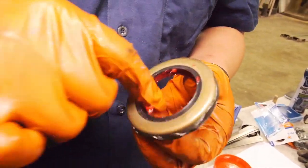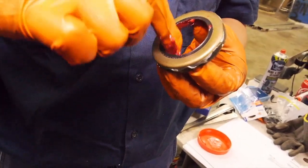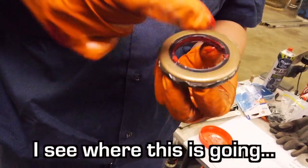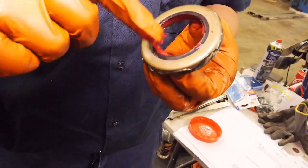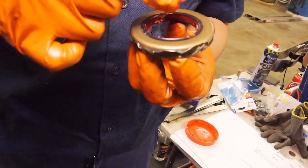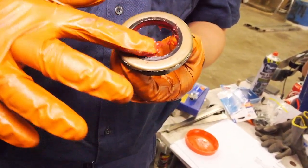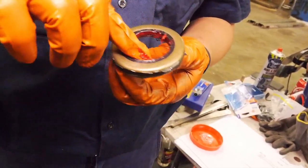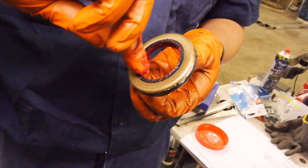The grease helps to stop the lip tearing - nobody likes a torn lip. So when you slide it in over the shaft, that's part of the reason why we put the seal in afterwards as well, because the spline on the end of the shaft where the tail shaft flange goes can tear up the lip and then you'll have a perpetual oil leak and you'll be back again to do this.